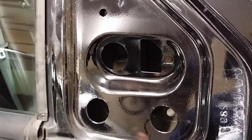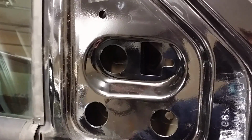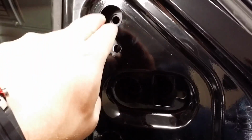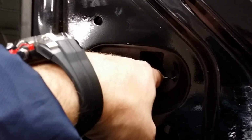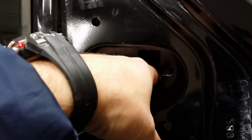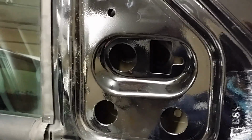to the truck. Before reinstalling your mirror mount using your 3 bolts, be sure to run your new power wire through the square opening here and into the cab of the truck. Run the full length of your wire and then reinstall.